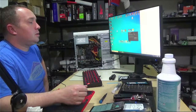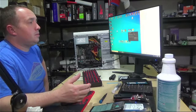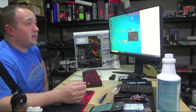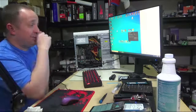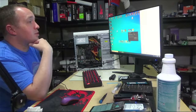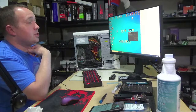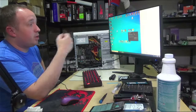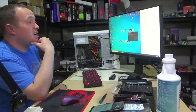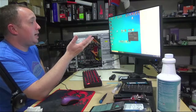So we're getting the max we've seen on Core 0 is 57. Again, though, the core to core temperature range is really tight. 7 degrees core to core. Core 3 has a max temperature we've seen so far of 50, and Core 0 is a 57. And the average temperature since boot up, or since I started HWiNFO, is only 5 degrees apart, which is like, that's nuts. 2 hours. What are we doing, guy?